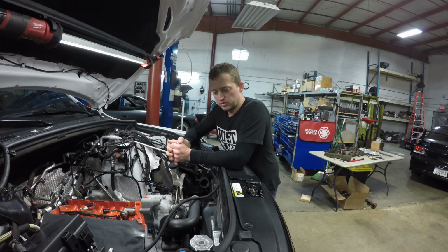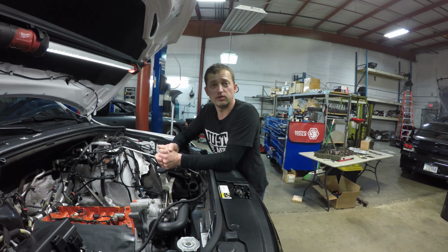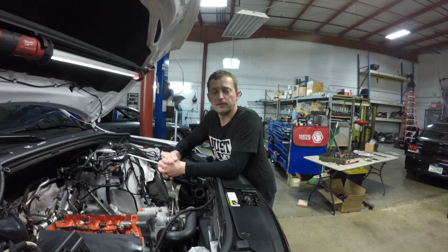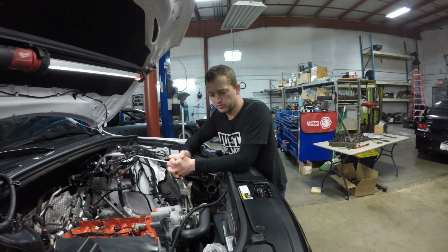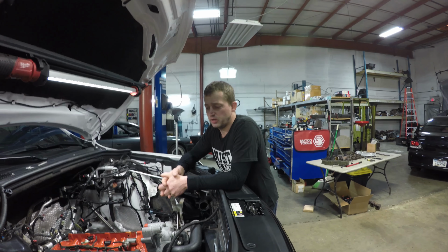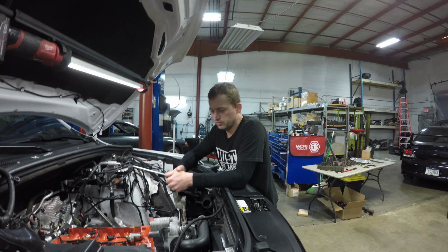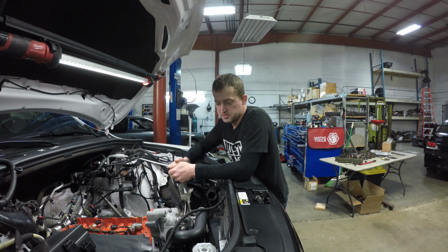On this truck, I would reckon it'll be about 25 horse. Okay. But I could be wrong here. It could be 50 horsepower, but then again, I guess my thing is we can just turn the boost up. We're not on a supercharger where we need to squeeze every last bit of power out. When you limit it with what you can put in as far as air, you need to make it as smooth an entry as possible on the stock 6.1 head, which, I'm sorry, 6.4 heads are much better than a 6.1 head.